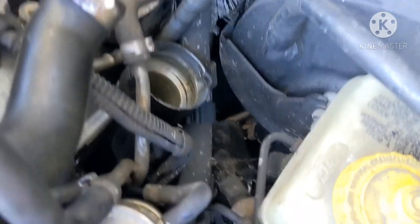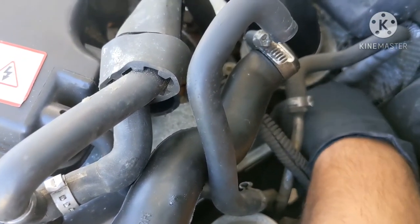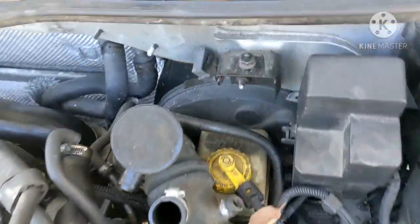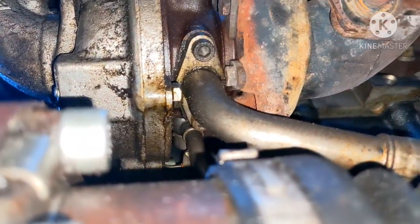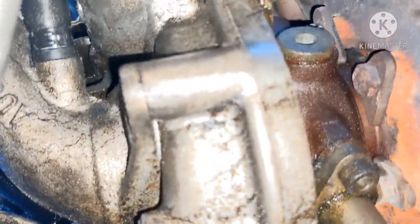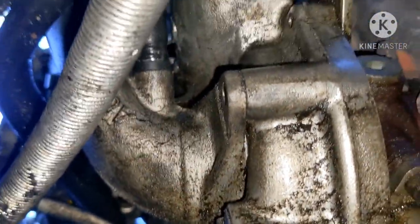To continue on to the air inlet, I went underneath the car and unbolted the hex. Let's finish removing this — just one more clip and then at least this part is off. Now we're going to move to the bottom of the car. There's a 5mm hex nut that I had to take out — here's the bottom of the inlet, and right here was the other hole where we had to break the clip. I don't see anything else holding it in place.